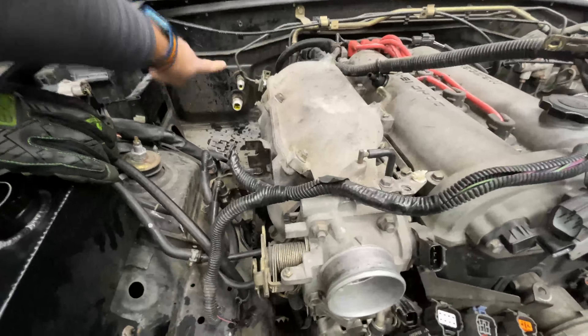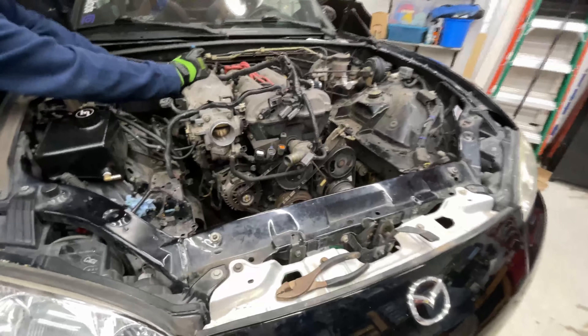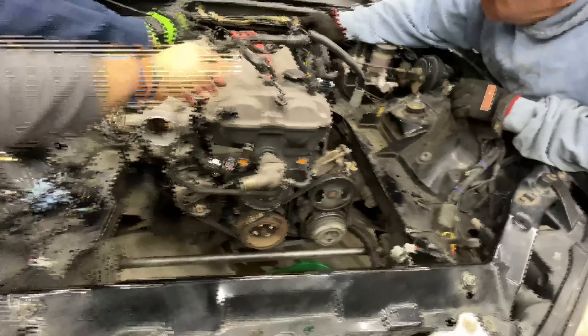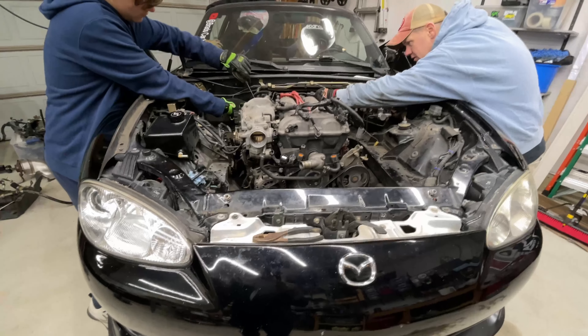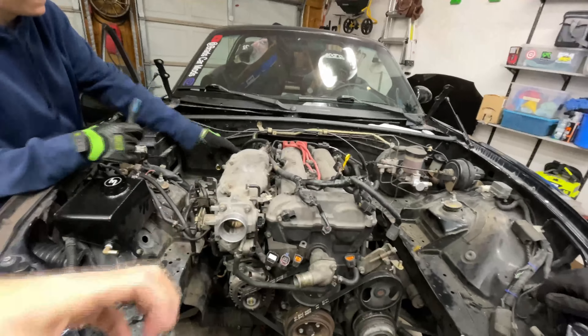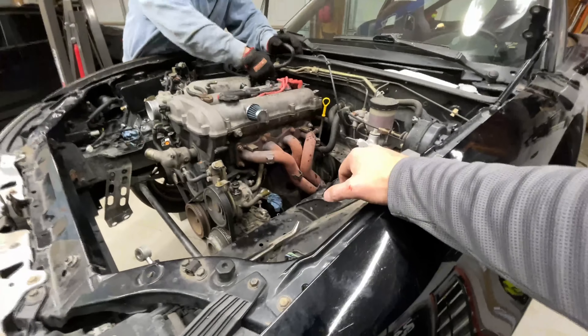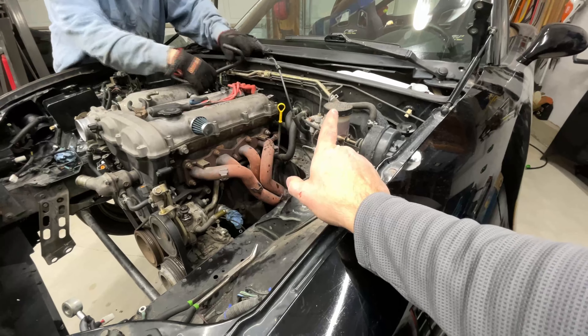Back underneath the car — the AC is deleted, so the AC lines that come through the firewall to the evaporator core are all disconnected. The wiring harness has been disconnected — that's the Mazda BP4 wiring harness and we're putting in a Honda, so that harness won't be used. We're just getting stuff out of the way; eventually we'll disconnect it to a point because we're going to use some of the harness inside the car and do an adapter between the Honda wiring harness and the Mazda side. We still need to disconnect the sway bar, heater hoses through the firewall, clutch, alternator, and a vacuum line — then we should be ready to pull.